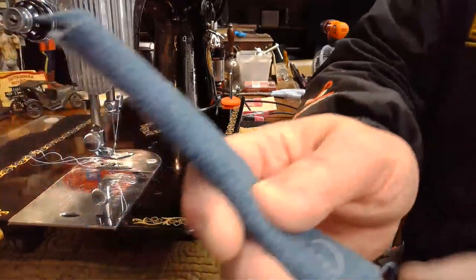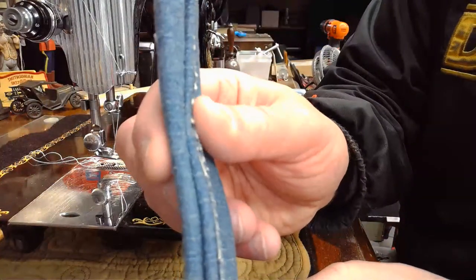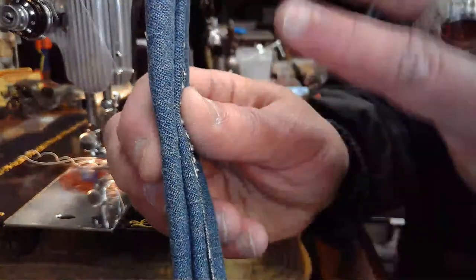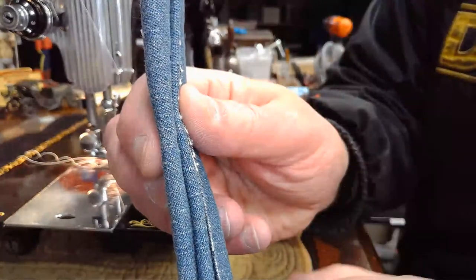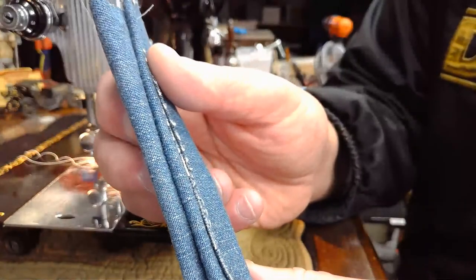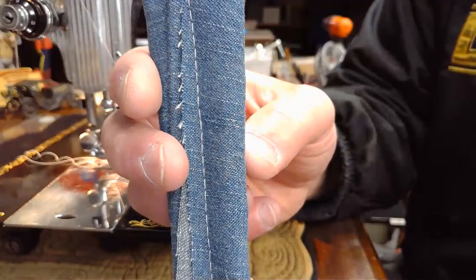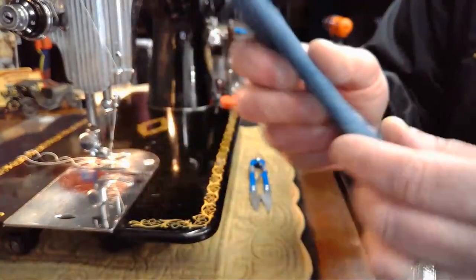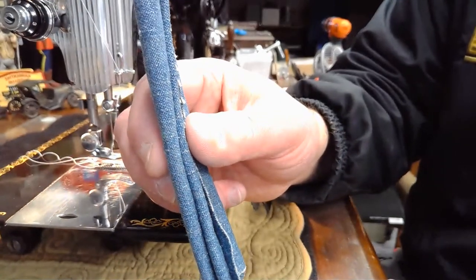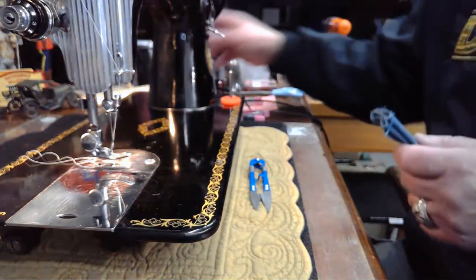So you just have to take into account when you're sewing at this level, for a single sew off, you can get away with it. But if you're going to be sewing denim all day long, you'd be wanting to use a denim needle. You'd be wanting to use a setup that's more suitable for this type of material. You just would. But I'll tell you one thing, there's not a lot of machines out there, 1591s, that can sew through 8 layers of denim like this.